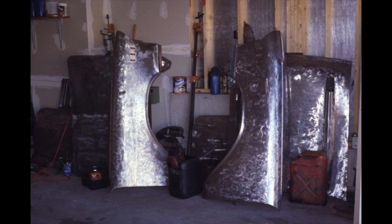We ground the old paint and bondo off the fenders, hood, and rear deck lid by hand with drills and grinders. Every fender, door, and quarter panel had bodywork done - the car was about 30 years old and needed a lot of work. The only really severe rust was right behind the front wheels in the front fenders. Phil cut out the rusty sections, welded in new metal, covered with bondo, and sanded it down. It turned out great. This was not a show car - it was intended to be a driver, a hot rod.